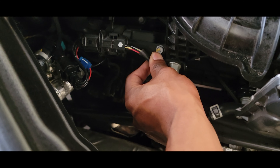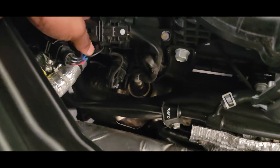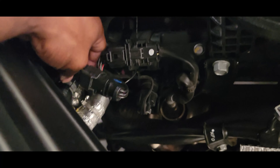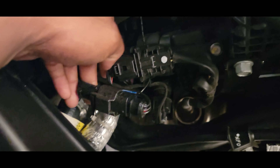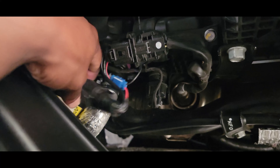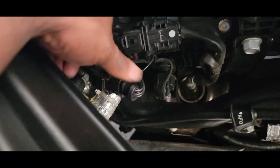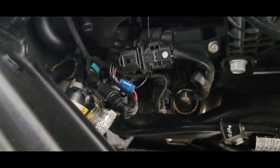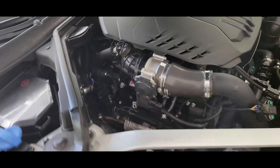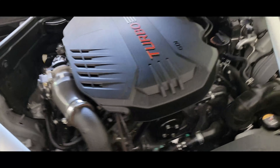You'll see it has a red wire also. You can see I ran it there, just covered up by the engine cover and under a few wires. With the quick connect, simply unplug, plug one side to this side, plug the other side back into the O2 sensor — and that's as simple as it is for the quick connect.